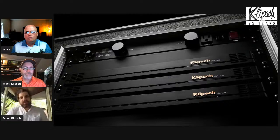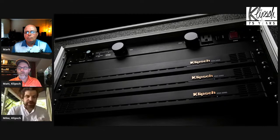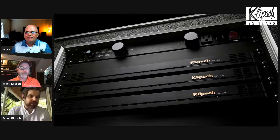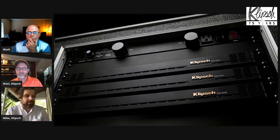The KDA amplifiers are digital amplifiers. A lot of consumers think about AVRs, where it's your source and it's also powering the speakers. You can plug your Apple TV into a receiver, and the receiver will take that signal, decode the surround sound, and then power the speakers. The KDA amplifiers are purpose built to power the speakers only. On the back of them, they have RCA inputs, so line inputs from a source, whether it's a streaming device or really anything with an analog output. We mentioned Klipsch Stream products, so a Klipsch Gate or even a Sonos Port can plug right into the back of this.